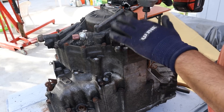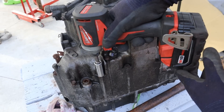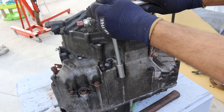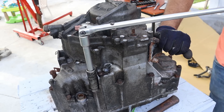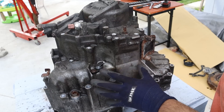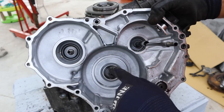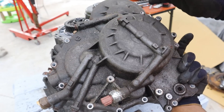I'm going around and removing all the 10mm bolts that hold this back cover on. Next up are the 14mm bolts — these are like head bolts. Once cracked free, I'm going to zip out the bolts. Before the case can come out I have to remove the reverse idler gear, which is underneath this cap. Inside the casing you can see there are little tubes that feed the clutches inside the countershaft, and there are also embedded lines inside the casting.